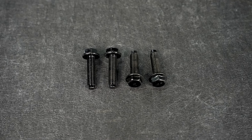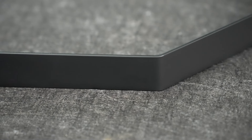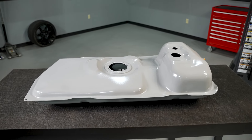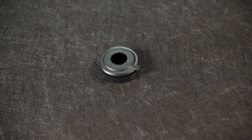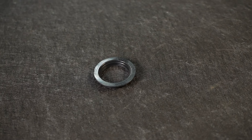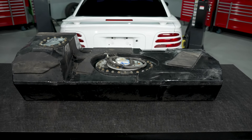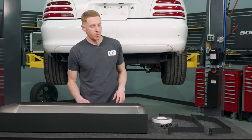With the nut plate you get two speed nuts and two retaining bolts. To attach the two straps, we're also giving you four brand new retaining bolts. Another cool thing about the straps is that they closely mimic the width of the straps on the 2000 Cobra R, which further adds to the accuracy of what we're trying to do with this kit. Like the fuel tank cover, these are powder coated in satin black as well. If you own a 2000 Cobra R, you'll get all of the previously mentioned components plus a 99 to 2000 fuel tank, a 300 liter-per-hour fuel pump, fuel filter, fuel tank pad kit, filler neck grommet, vapor valve seal, and a tank pressure valve seal — everything you need to convert from the factory Fuel Safe fuel cell.